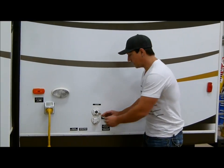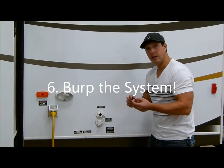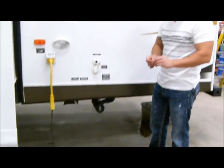To get the city water connection winterized properly, it's real simple — all you're going to do is pull the screen and blow it out, just push on it a little bit. All the water will come out, it'll be pink there, and then you know you're not going to wreck anything in the winter.